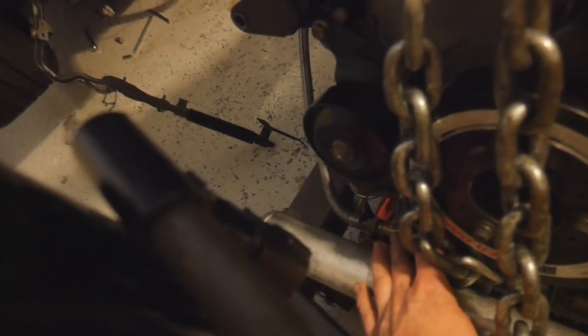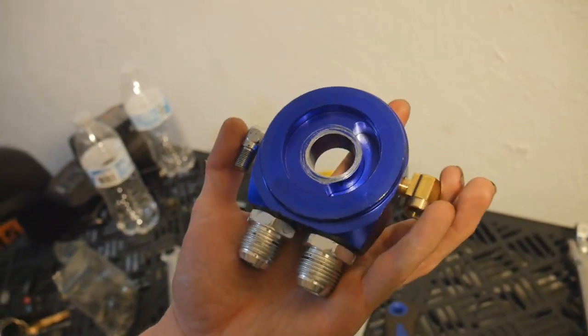But good news is I ordered all of the parts that we need. We got some upgraded wastegate springs, we got all brand new couplers - not just the little ones I replaced earlier in this video, I mean all of them - so we're not gonna have to worry about any bursting couplers and having to remove the motor again. We're also going to be rebuilding the turbos. I went ahead and purchased some Mamba Tech TD05H - these are the 18G turbos from Gretti. I bought some rebuilds. I was also looking into the billet turbines, but they didn't really give any gains whatsoever and they're really expensive. So I'm gonna stick with the regular turbines. We're gonna rebuild all the bearings, replace all the seals, and I'm also getting some turbo restrictors. We're gonna turn the oil feed into this sandwich plate instead of feeding them with that oil pressure line - we're gonna use this sandwich plate to feed both of the turbos. I went ahead and ordered a new seal for this.